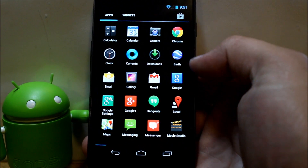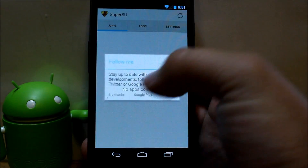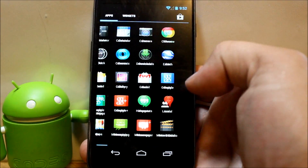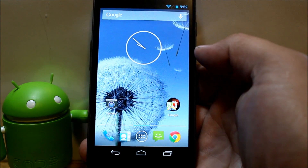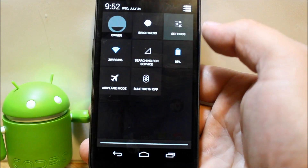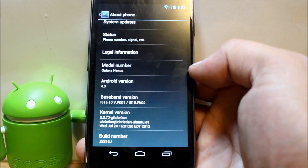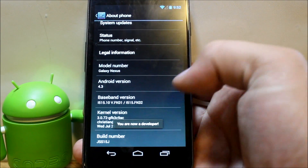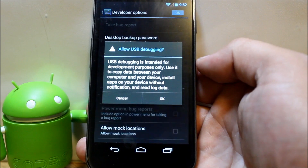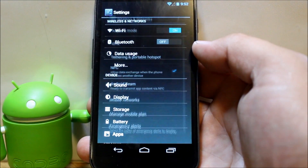There's no cellular signal because there's no SIM card in this device, but everything else is working great. SuperUser is working, so you should have root access from flashing that SuperSU zip. If you want Google Keep back, just re-download it from Google Play. For developer options, go to the build number and keep tapping it to enable them — then you can turn on USB debugging.